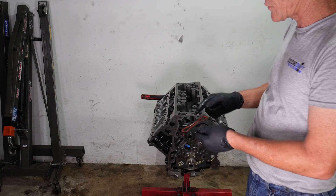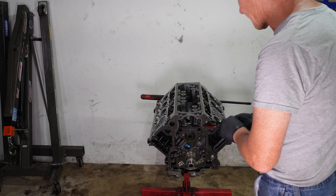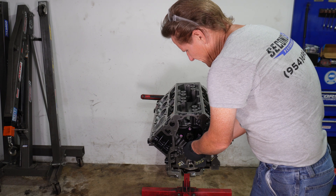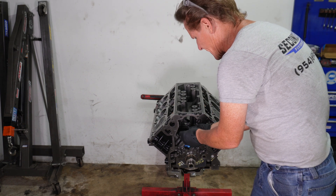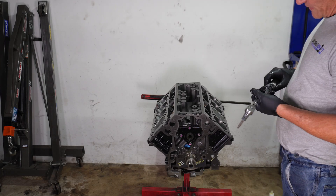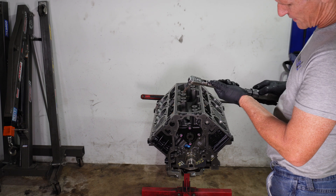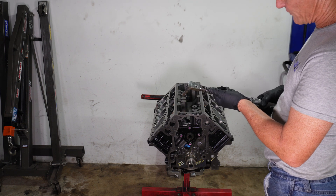But this is brand new — it was torqued down, but you can still feel the lip of the seal, so this is okay. They're M8 bolts, and we're using a T40 Torx bit to tighten them. If your camshaft thrust plate has hex head bolts it goes to 18 foot-pounds; if your camshaft retainer plate has Torx head bolts like ours does, it goes to 11.